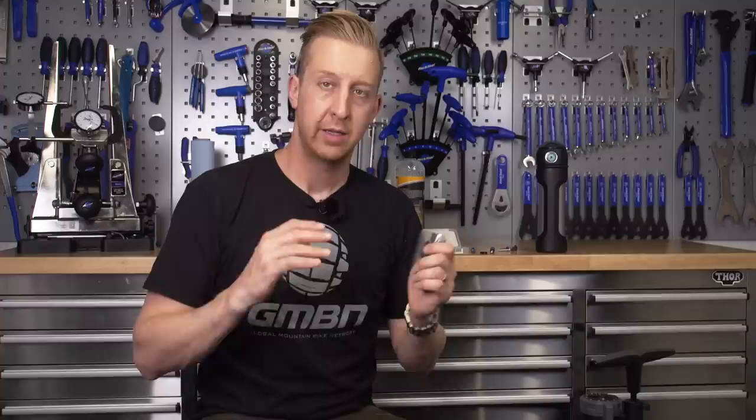As you can see, it's definitely a messier method — I've got to clean the tire and the floor as well. We successfully set up tubeless tires with two different methods. It's all about the fit of the tire on the wheel. You can get a slightly better fit by running another layer of tape around there, and doing the dry fit method really does help, because you can be certain something's going to work before you waste sealant and get the stuff everywhere. It's definitely the better way to do it.